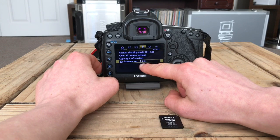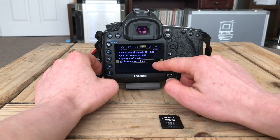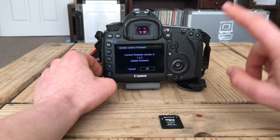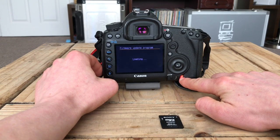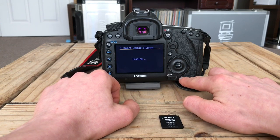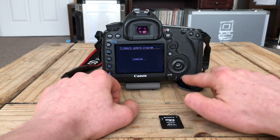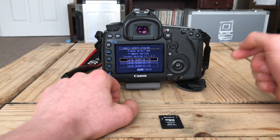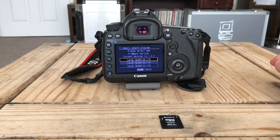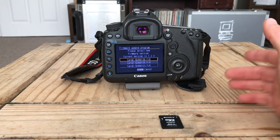Put in the card with the 1.3.6, start your camera up, and go into your menu. For me it now says 1.2.3, as you can see — for you this will say 1.3.6. Go ahead and look at this little light right here. At the firmware update program, at the very beginning this light will glow red, which means the camera is accessing your memory card. It is looking at the firmware inside the card and checking its hash key — verifying whether this is firmware it is allowed to load.